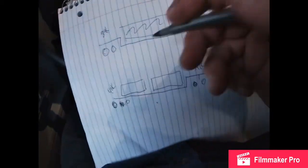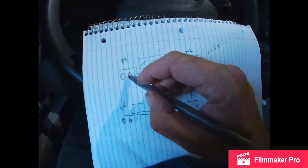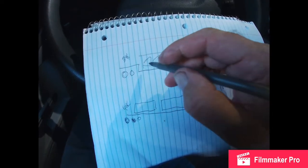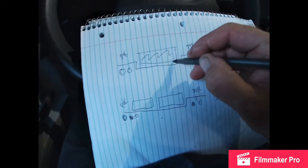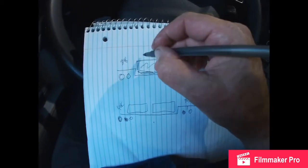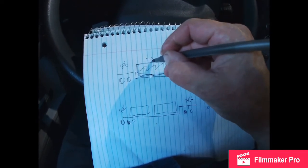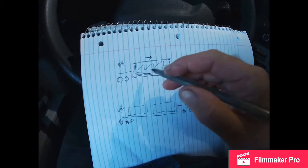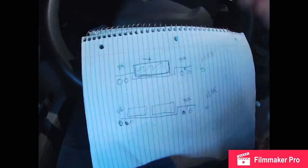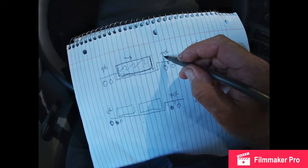So let's say I roll through the scales, and here I'm over 34,000. I can't take this load. Two things have to happen. They have to take some glass off, or they have to move the glass forward. What you do is you always move your load away from the overweight. So if they can move it forward and bring this below 34K, I'm good. Now let's say they move it forward, and on this axle I'm 34,500.